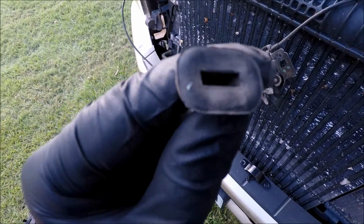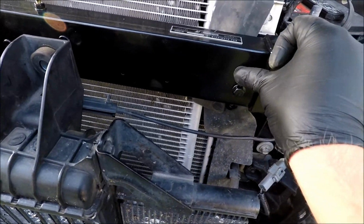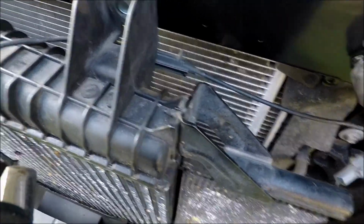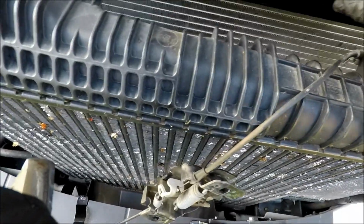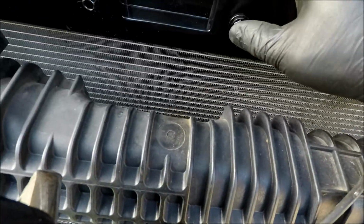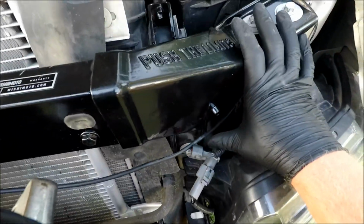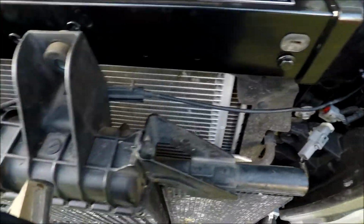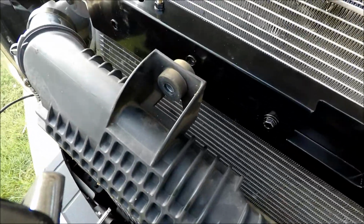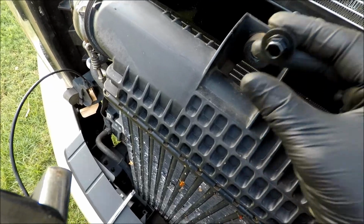It's this little rubber grommet for the horn. Just take it out, slide it in right there. And these bolts that hold the horn and the cooler right here, they're 12 millimeter. These are still 10 millimeter, and these are still 10 millimeter. And just reuse the 13 millimeter bolts to hold all this stuff in. And also, you get new bolts for the intercooler, and these are also 12 millimeter.